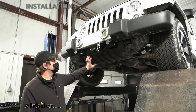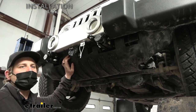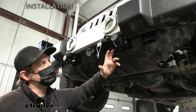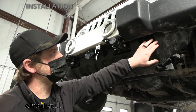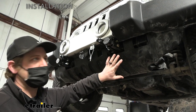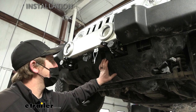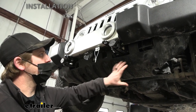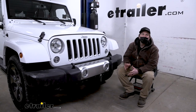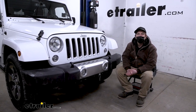I went ahead and got all these cut out and the underbody panel is back up in place, reinstalled the opposite way that we removed it. You might have to test fit it and make another cut — I actually did have to do that on the driver's side where our base plate sticks out a little bit, so I made an opening there to clear it. Everything's tight, but it did go back up in place. And honestly, I think it looks pretty decent — about as good as it can given all the new components up front. And that'll finish up our look at and our installation of the Demco base plate kit on our 2018 Jeep Wrangler JK Unlimited.